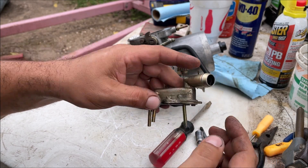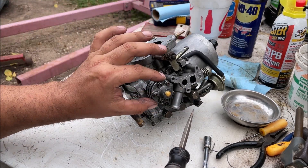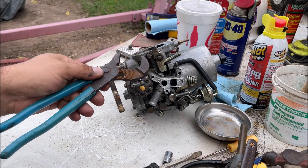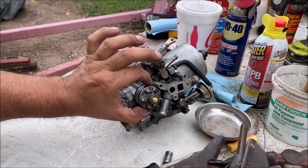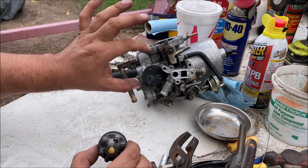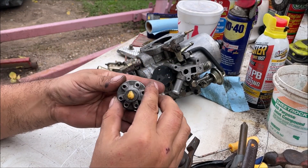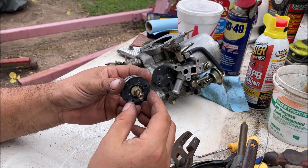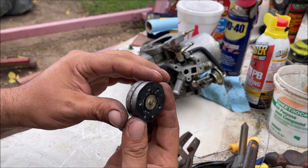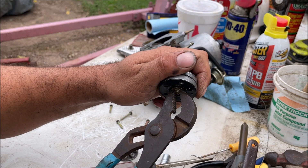What in the heck is this? These are engine manifold vacuum ports - I don't know what they do yet. Okay, this is your power valve right here. We need to inspect this 100 percent, but be careful - you can rip all your gaskets. Warning: take this off at your own risk, you can damage the diaphragm or rip apart your gaskets. This carburetor appears to have been rebuilt in the last 20 years at least. You've got three long and three short screws.